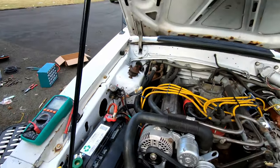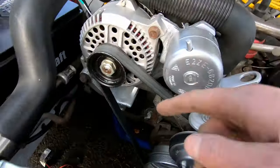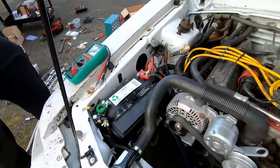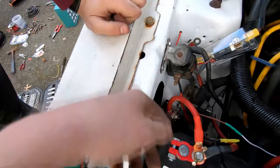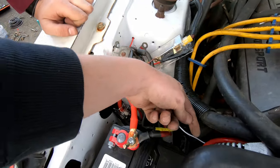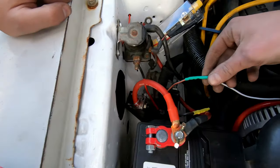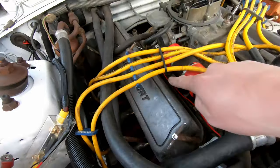So what we did, I don't know if we showed you, but that wire that we took, mounted from back here, brought it down there to where the ground is. Took this wire around here, got the fuse down there. We're gonna mount that soon, when we take the wheel off so that we can get it nicely firmed to the chassis. Wire's going down around here to the alternator. We have this wire going into the wire we showed you earlier. And then the carburetor wire for the choke is going over there and there.